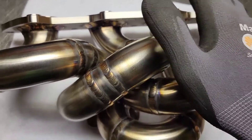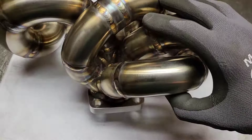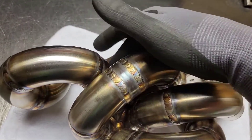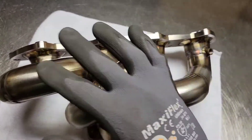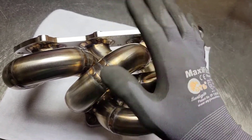So why is this all important? Why do all of this? Why not just use a tight bend, or why not just make the exhaust find its own way out? Why make room for this bend, and why aim each runner so carefully? It's to let the exhaust keep moving. Gently guide the exhaust in the direction you want it to go, and don't force it around a sharp bend or corner. Just let it keep moving.